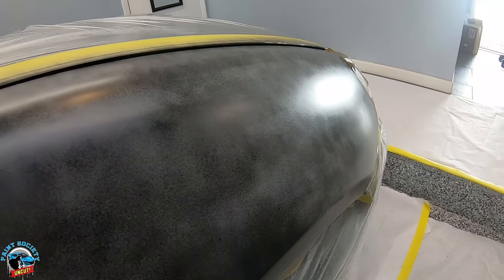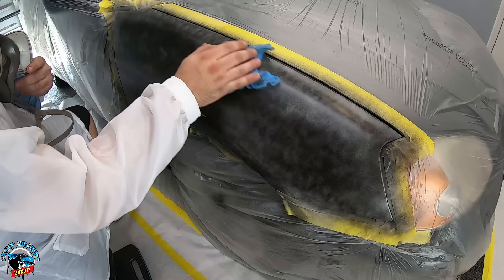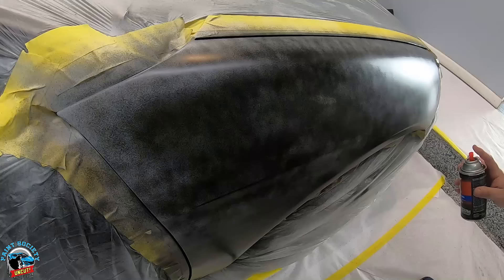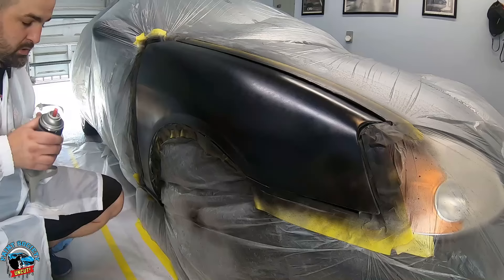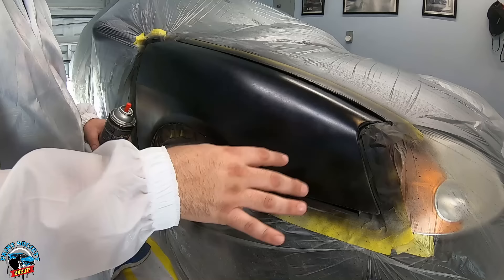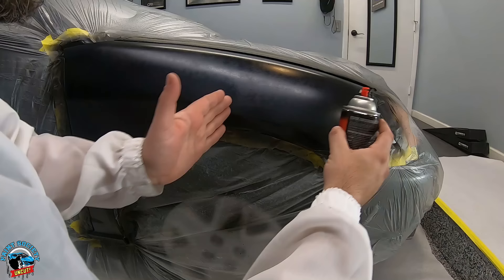The first coat is going on pretty smooth — it's going to be stripey, but don't worry about that. We'll clear things up in the next few coats. After about 10 minutes it's pretty dry. Run your tack rag over the surface and apply the second coat. My distance is around four to five inches and I work small areas. The paint stays wetter that way, so it dries smoother. If I'm all over the place it's going to land dry, and the clear coat on top will be dry as well.